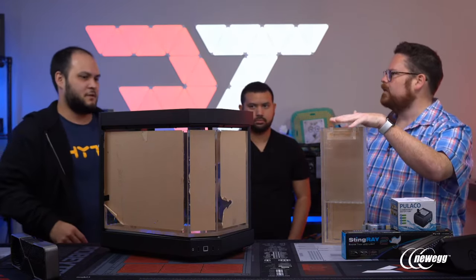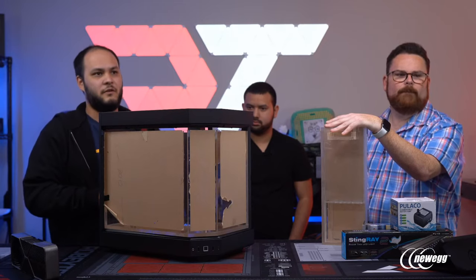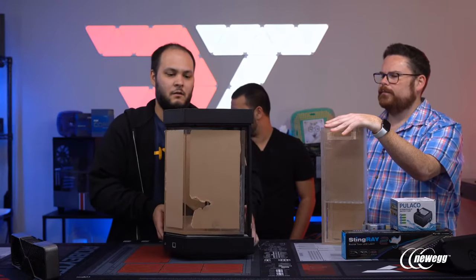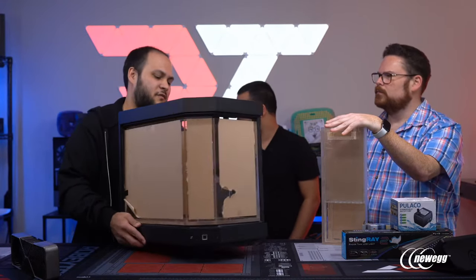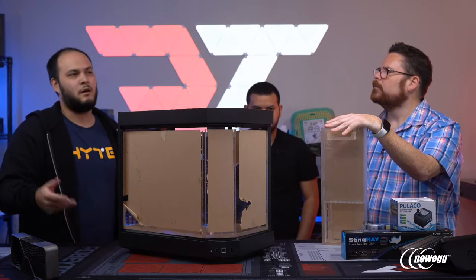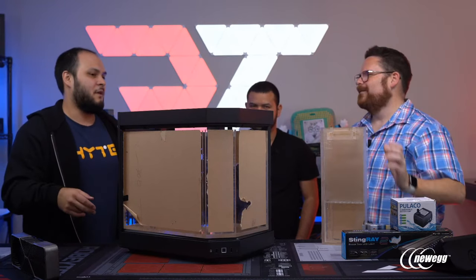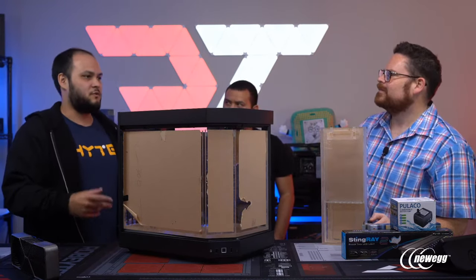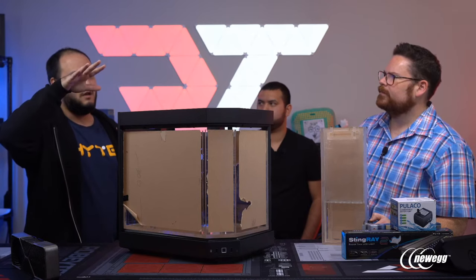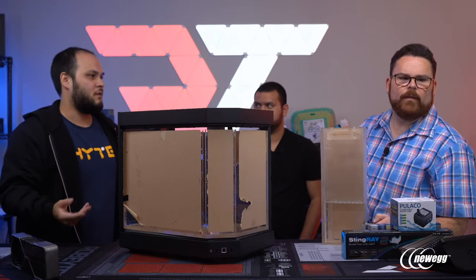Radiator support. That's in the specs. So in the Y60, you have on the side of the case support for a 240 or a 280 radiator. That part of the case is very wide if you look at it. At this angle, we measured 150 millimeters from the back of the case to where you might start running into the back of the graphics card. There is no combination of radiator and fan on the market right now that gets you to 150 millimeters thickness. So you can put a push-pull, ultra-thick radiator if you're doing a custom loop, and all that will fit. And at the top, you can fit a 360, a 280, or a 240. So you can get dual radiators, 360 and 280 is basically the most you can load it up with.